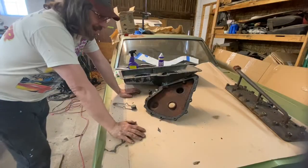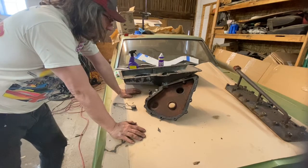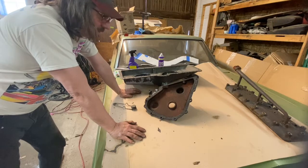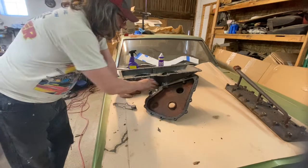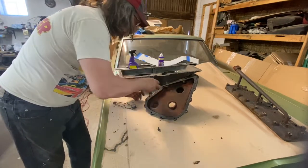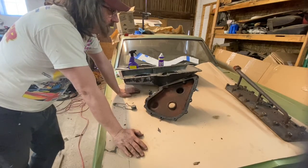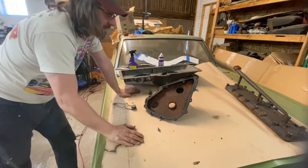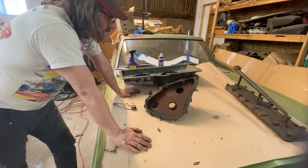We're not dealing with a 500 or 1,000 horsepower high-performance engine that's going to have gobs of blow-by and high oil pressure. It's the context of what this is. The ability to seal an engine of this vintage is not nearly as difficult as a high performance engine or even a modern engine in some ways. So it doesn't need to be high tech. That's why a lot of these were just thin paper gaskets. I didn't check flatness or anything on that. I'm not worried about it at this point.